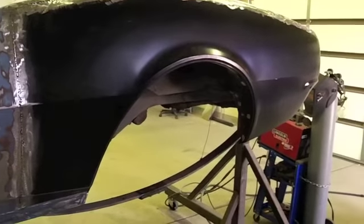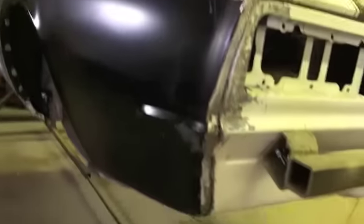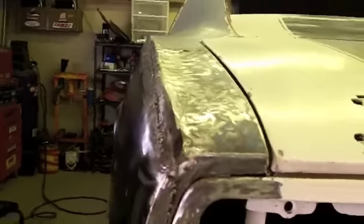Here's another update on the Camaro. I've got the driver's side quarter skin probably 80% welded. I ground the weld down real quick — I've got a bunch of little pinholes I need to go back and fill in, but for the most part it's on. That back piece is just beat to hell, but now that it's got the quarter welded to it and it's a little more solid, I'm going to try to hammer and dolly it as best I can.